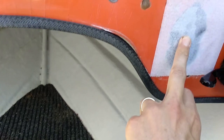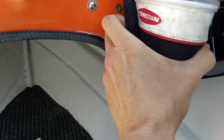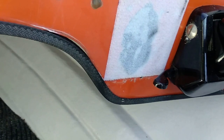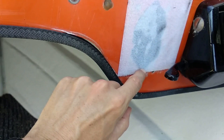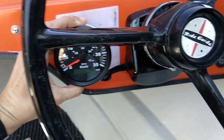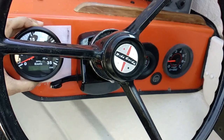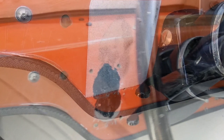On this side there was another hole that I'd since filled, and then I had a giant Velcro block where I had a holder for drinks and keys. I'm going to take this off, remove this Velcro, and measure this area — it's actually slightly taller than the gauge, ever so slightly. So I'll probably need to make a new, slightly larger ring template that sits around to cover the edges. There's also a hole down here I need to cover, and then obviously that'll be a circle in which this can be placed. This will look pretty good here — sitting up higher, a pretty good spot to see the speed, and it will have cleaned up the whole side of the dash.